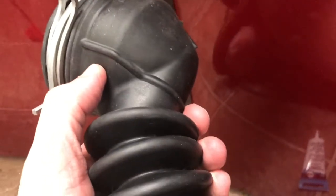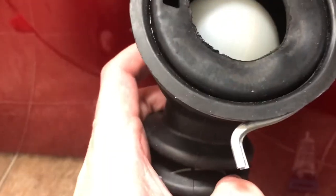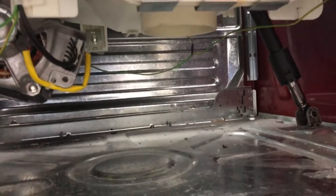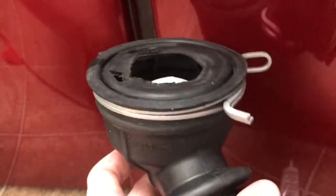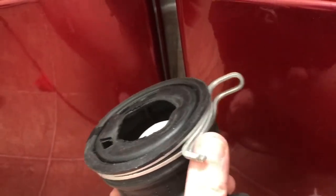So our pump is all nice and secure, in the right place directionally. This is by far the hardest thing you're going to have to do with this pump replacement or drain pump replacement. These are a pain in the neck. You do want to ensure there's nothing stuck in here before you put a brand new pump on, or it's just going to screw up the impeller that's pushing water from the drum down into the drain hose and into the pump.